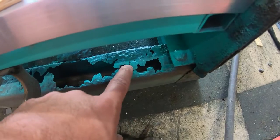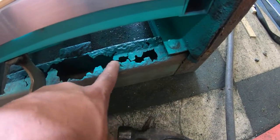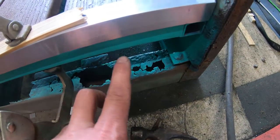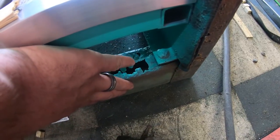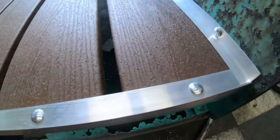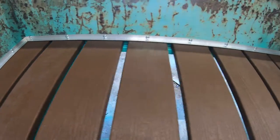This section here - you can see it's rusted - this is not bracing for the bed at all. The bracing all runs off the frame. I made this right here and I've just kept it in as something to hold my diamond plate. I've spaced them out evenly all the way along the bottom, along the sides for the side rails, and along the front, and tied it in real nicely at the corner on both sides.